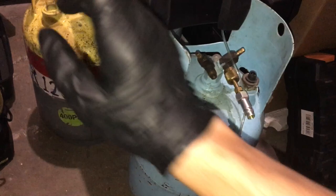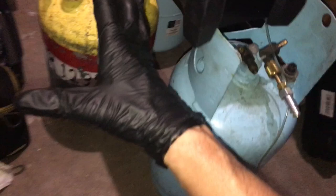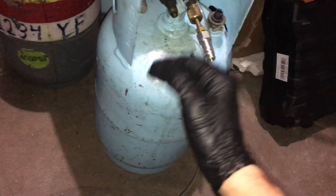I was away from my shop so I couldn't grab another cylinder, so I just overfilled them — not practicing OSHA-approved methods. Here's my R134a — by the color coding you can see, I color code my recovery tanks. I've got the white and red indicating R1234yf, with my knobs labeled YF on them and it written up there, so I never make any mistakes. Color coded for my clean refrigerant — this is just recovered.